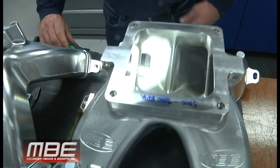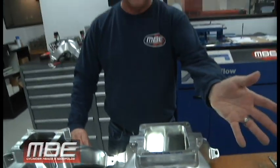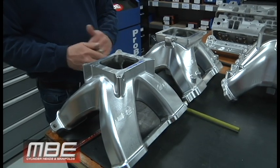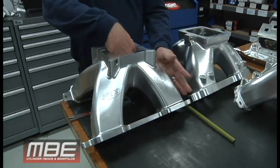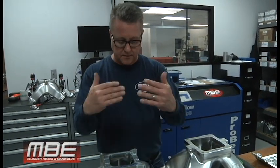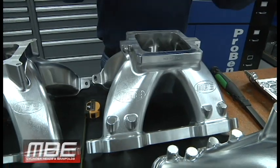An inch is a significant amount when you're trying to move the RPM range down low. Drag race applications typically leave the starting line around 5,000 RPM and run anywhere from 8,500 to 10,000 RPM depending on cubic inch. For road racing and super late models, 8,500 is a very common number. The longer runner is why this manifold moves the power band down lower — it makes the engine run at a lower RPM — while the shorter runners here make it run at a higher RPM.